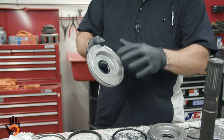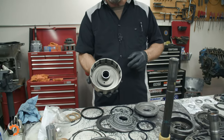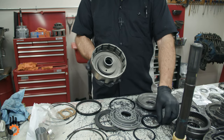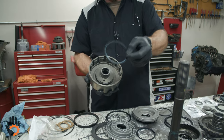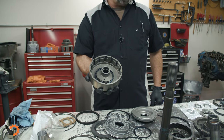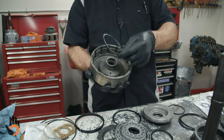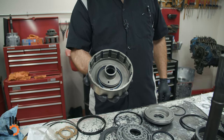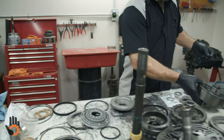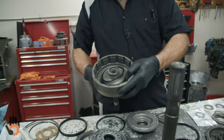One thing that will confuse you slightly on this though, is each of these drums also has an inner seal that goes into the drum itself here. Okay, you noticed that probably when you took it apart. Difference being, the lip on that is going to face up like that towards you. Okay, I'll explain that a little bit later. But just so you know, that lip seal does not face down. It faces back up towards you in that direction. So both of those are the same once again. Easy for those to be determined. They'll go in here just like that.